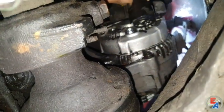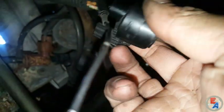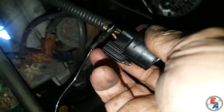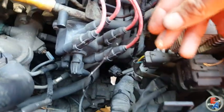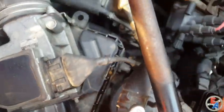Here I have the main 3-wire connector removed from my rebuilt alternator, and I've already soldered in a wire to the black and yellow wire. You've got to make sure you solder these wires in, because if you don't — just twisting it and wrapping with tape — it will come apart. It's really important when working on cars and race cars that vibrations will cause wires to fail. Make sure you unplug the battery before you do so.